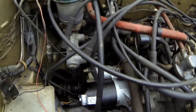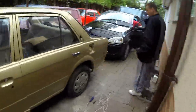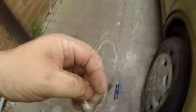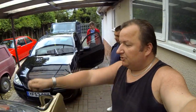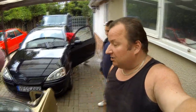Jimmy's here now and we're going to try and put the rear windscreen back in. It looks like it's got all old stuff on it but this is a brand new one — new old stock, been in storage for years. This cost me 90 pounds, believe it or not. All this on it is old grease — I've tried to wipe it off but I'll have to clear it properly once it's in. What we're going to do now is use the old rope trick — a bit of nylon cord laid around the inside groove. We're just going to get some washing up liquid to rub on the inside of the rubber seal because it's very dry.